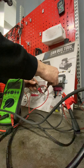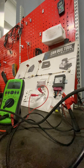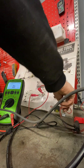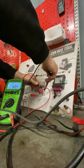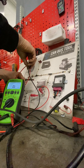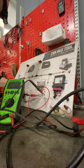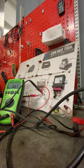Just a quick test of this too - what I'm showing you is how you check the circuit resistance on the CAN bus, but I'm doing something wrong. What am I doing wrong? Well, I've got the battery connected, so you can see we've got zero ohms - continuity to each other. So the first thing we have to do when we check a bus system is disconnect the power supply. That way we can get a true measurement without the bus being active, without control units being powered up. We recheck across the bus again and we should have 60 ohms, meaning the whole bus is intact - the terminating resistors at both ends are working and functioning. Now of course if we have an issue and we don't have any communications with a node or a branch line control unit from the main line, we can induce that fault and see what it looks like. The first fault we're inducing is when they're actually going to be shorted together and you're going to see some strange values - for example 3 ohms - you won't get the normal resistance value of 60 ohms at all.